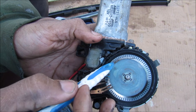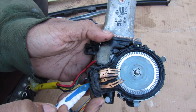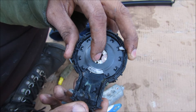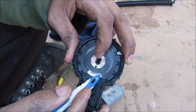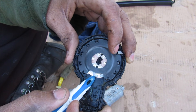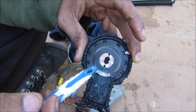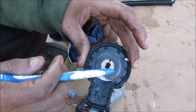Constant ground is supplied to one line, and a pulse signal is going to be generated to ground through the blue line. The two prongs on the outside don't touch the ring on the inside — those correlate to the ring on the limit switch. Now if we take a closer look at that limit switch, you'll see these little gears inside driven off of the final gear ratio of the motor. There's an outer conductive ring with a little stop when it reaches the end, and also a little gap in the conductivity of that ring. So when those two prongs stop conducting, the motor and CPU will know to stop supplying power because the window has reached its utmost limit.